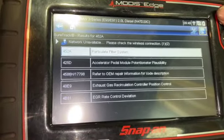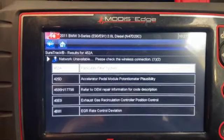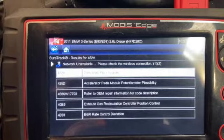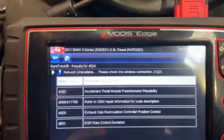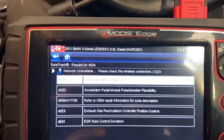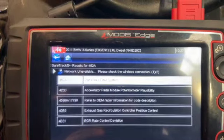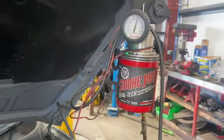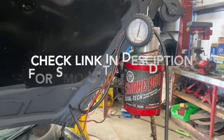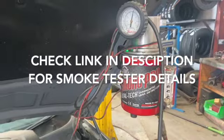So we're just going to disconnect the diagnostic machine now. The first thing we're going to do is put the smoke tester on, just to check for any leaks under the bonnet - make sure all the air pipes are sealed and there's no leaks from any vacuum hoses or like that, and then we'll look a bit further. So we've got the smoke machine hooked up. I've put a link in the description below to where you can get one of these from as well, because they're a mega bit of kit.